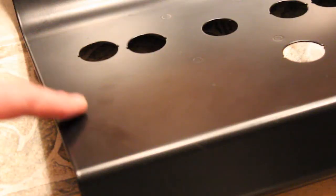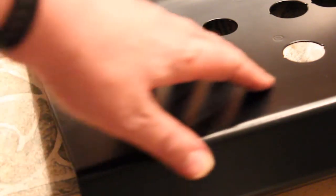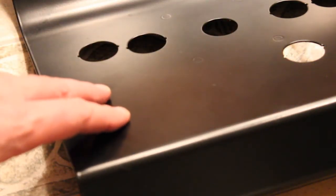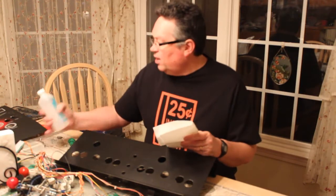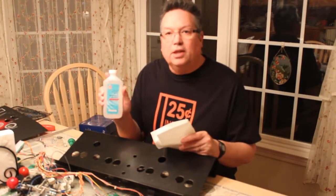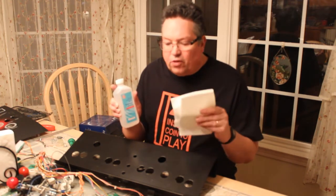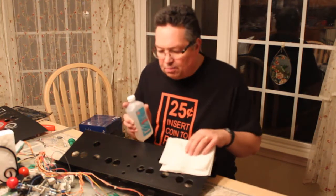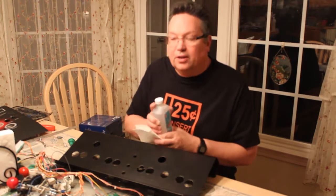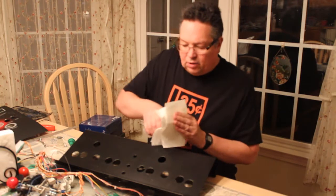The problem we have is that there's grease on here — this is probably from somebody's hands because your hands are real greasy. So this control panel has got to be wiped down with some alcohol so that we get rid of all that grease, and then the control panel overlay will stick to it better. We're going to wipe this down with 91% isopropyl alcohol to get off all the oils from the skin. We've had this in play for quite a while — it's been a couple of years since we started the project.